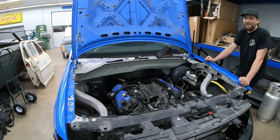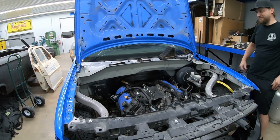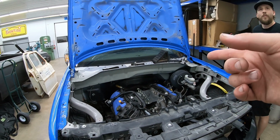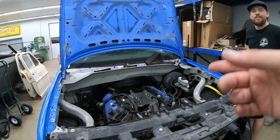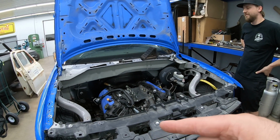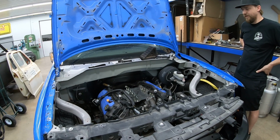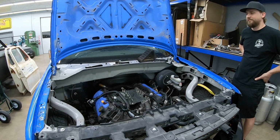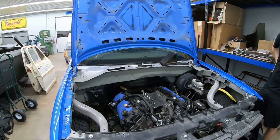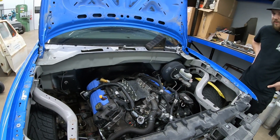In and 200,000 miles. I had several flushes in mine, and then my concern was the Coyote is a 3/4 line and the 10th gen is a 5/8 line, and I was like, I'm worried if I step it down, am I gonna then ramp the pressure up and blow the side of the heater core out? Yeah, didn't think about that. But it's been fine.